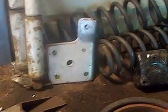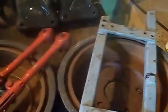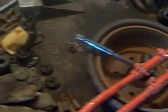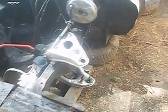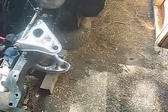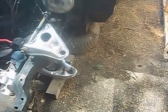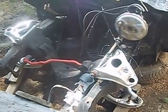have to order some new shocks and rear shocks and leaf springs and hangers. And upper and lower ball joints. Don't have a press, and I got to press out my lower ball joints. So I might have to buy a torch here and see if I can heat her up enough to knock them out. And I can start getting my front end back on.